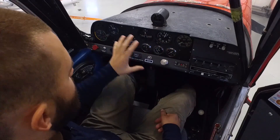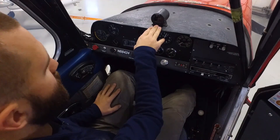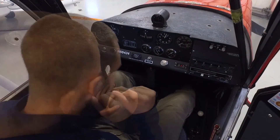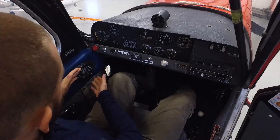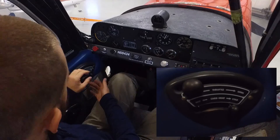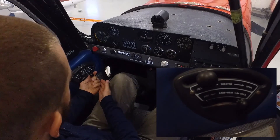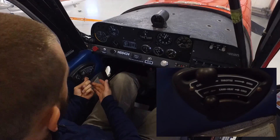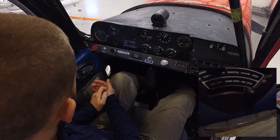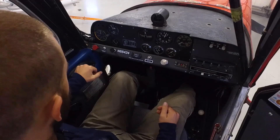There's your main center panel. One thing I didn't mention for flight instruments is the magnetic compass up here on top — that's another required instrument. Down on the far left-hand side, we've got our throttle on the top — all the way forward and back. And our carb heat is right below that: forward is cold, and pull it all the way back for hot. Really convenient to have those both right next to each other, easy to access while flying the airplane with one hand.